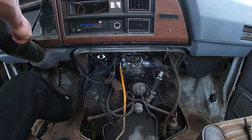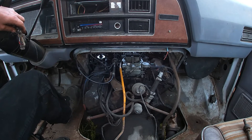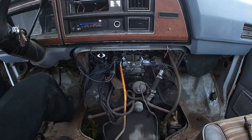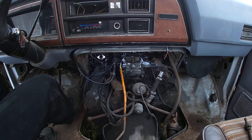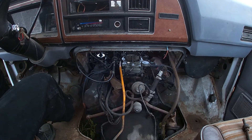A couple pumps. Looks like I'm going to set the choke a little better — it was a raw set anyway. Once we get it warmed up, we're just going to do a compression test.